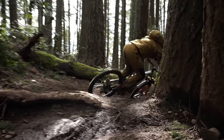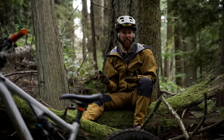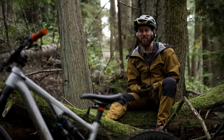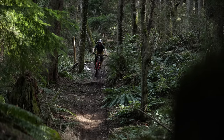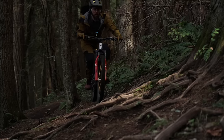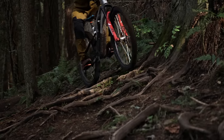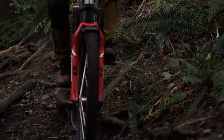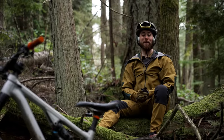Moving the bike in the air, it's not hard with the 29-inch setup. I honestly felt more comfortable because I knew I had more support when I went to land with that different linkage. I have a personal feeling that bikes respond best to good geometry first and foremost, then good suspension, then all the other parts. We changed the wheels and the geometry didn't actually change — we just lost a little bit of rear-end traction, a little bit of rear wheel rollover, and a little bit of smoothness. I wasn't seeing any advantages there. So let me know — what am I blind to? What am I missing?